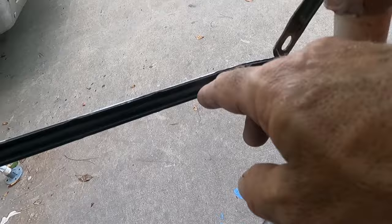And there's how the metal looks, nice and clean. It didn't take all that long, so I'm gonna go ahead and just finish the rest of this up. And then I got the struts to do, and the insides, bead blasting those in the cabinet after I do some stripping with this thing. The outside's all stripped. I got the struts. Still gotta do the inside right here. I'm gonna put that in the bead blast cabinet.